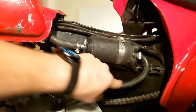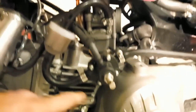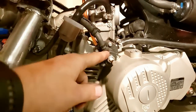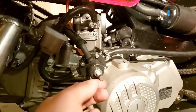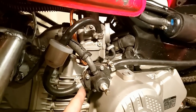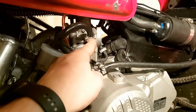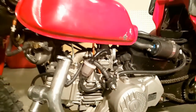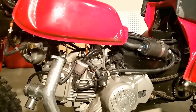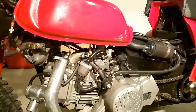This pumps up back here and into a fuel pressure regulator. You set that with this piece here, just turning and loosening it, and it feeds the carburetor through the filter and into the carburetor. I've set it at barely 1 PSI, and your float can hold 1 PSI.